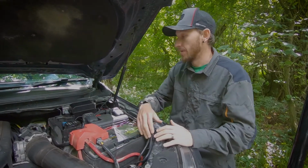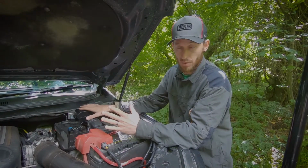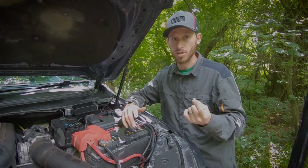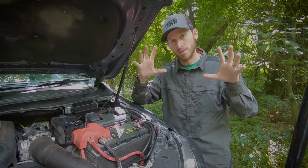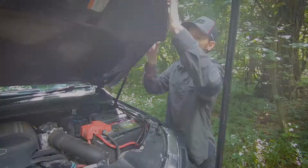So as long as everything's running off the two relays as we've kept it, each light bar has its own power supply, but it's all connected via one switch and one piggyback connector. So as soon as you engage those brights or those high beams, then both light bars will engage. So we'll show you that, how they operate.